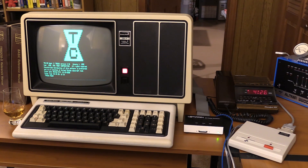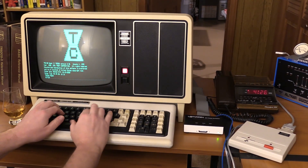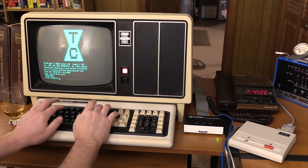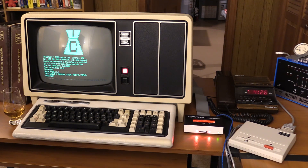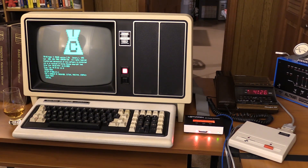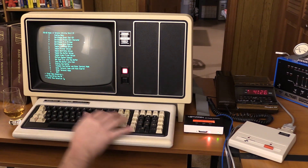This is the real online experience — we'll go online like it's 1982. First thing we're going to do is set the serial port up. You'll notice I'm using my Tandy 300-baud modem from the unboxing video — this is the DCM6. Now we're going to go into the terminal, set the line feed option because we need that, and go into terminal mode.